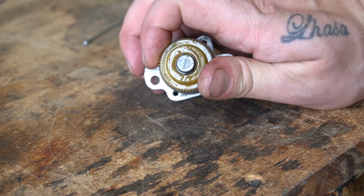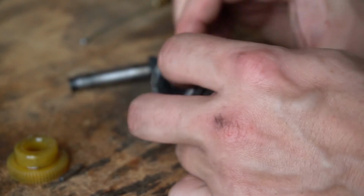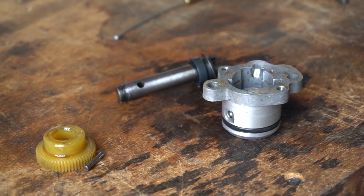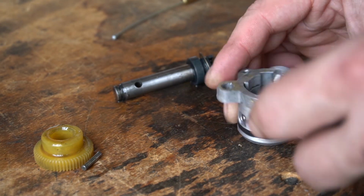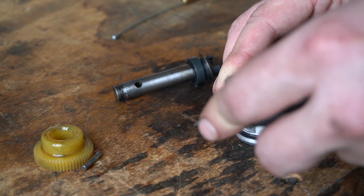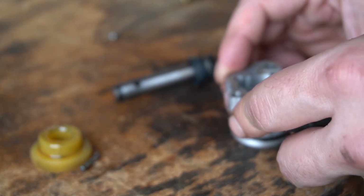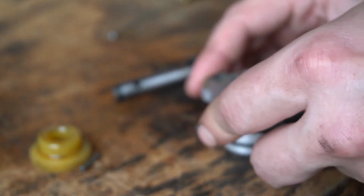There we go. Get that on camera. Cool. That can come off. That can come off. That can come out. A seal there that clearly wasn't really working. I'll use this really crappy old razor blade that needs to be changed. Scrape away the majority of the old gasket, and then I'll go back in with the Scotch-Brite.